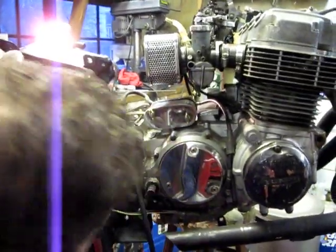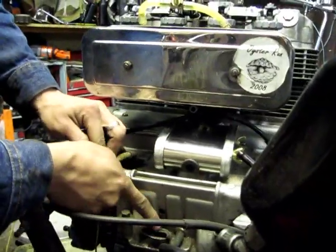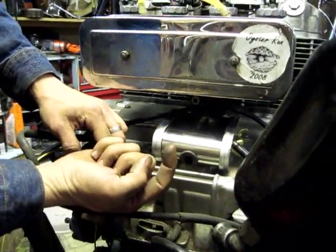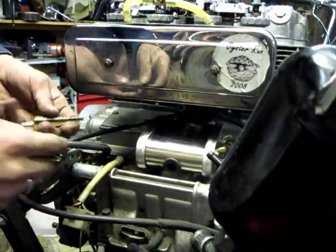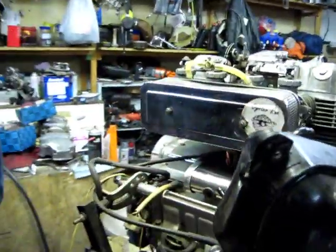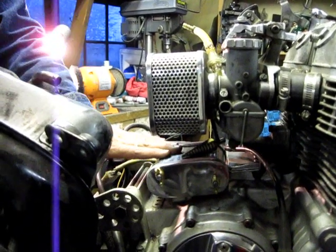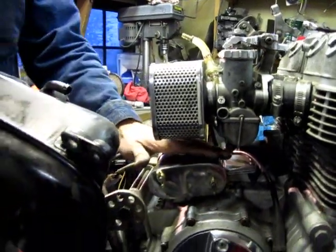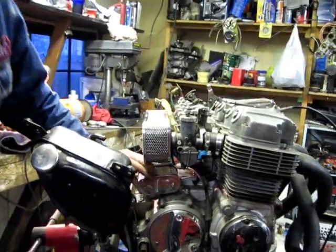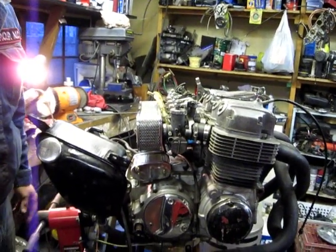Your wires come right through here through the back. You would bring your wiring up through your stock piece here, do a nice clean wiring harness with shrink wrap, and then shove one or two cables through there — gives you plenty of room. That is an oval key switch box. They come bare steel — all you've got to do is clean them and prep them for paint, preferably good automotive paint that's gas resistant in case your carb bowls were to leak. I generally do mine with cheap spray paint just because it's easy.